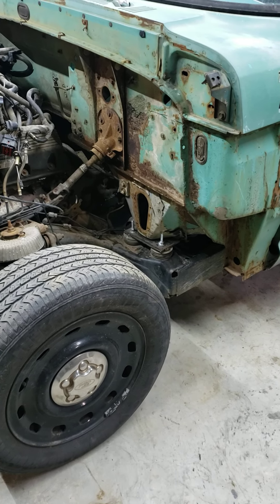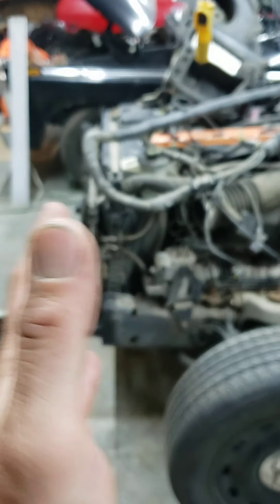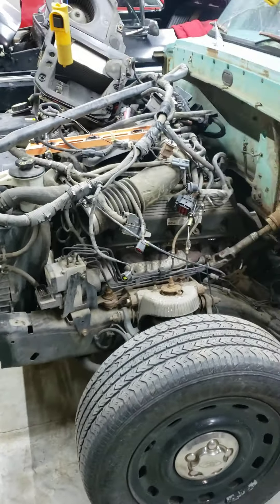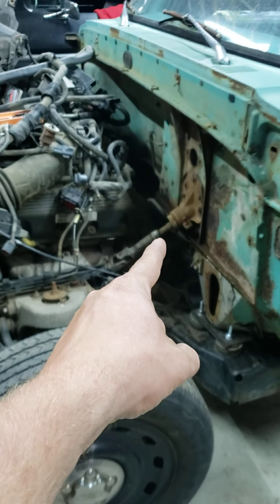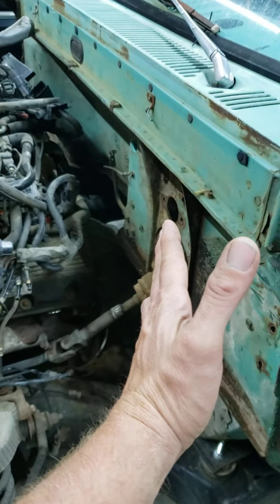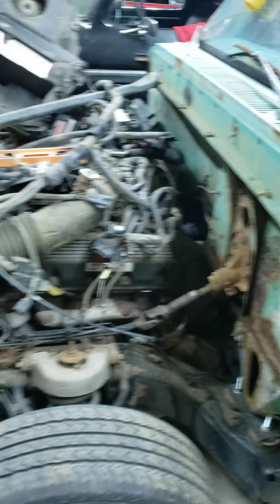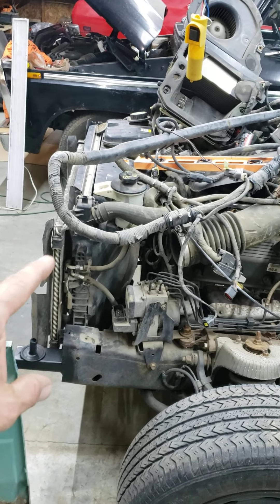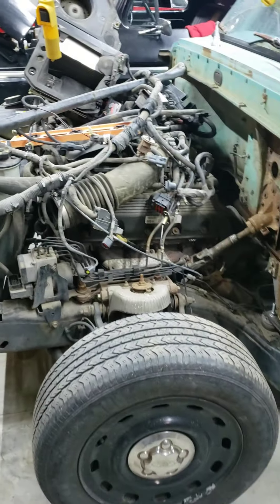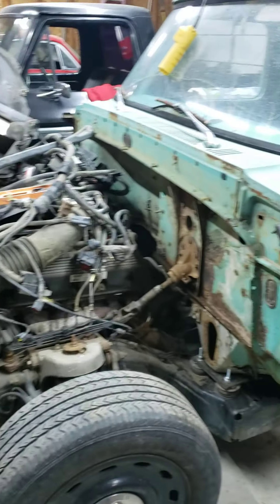A little bit will be blocked by the bumper but not a whole lot. Had some reworking to do since we're using the new-style cab front mounts — it slides the cab back so the wheels are centered inside the wheel well, which means the whole front of the truck comes forward more, so we have to play with that spacing. The more I look at it, the more I think it'd be awesome to shift the whole engine and drivetrain back, because as you can see there is a massive amount of room. You could really bob the front off and have plenty of room for the radiator. My dad mentioned going with a truck-style radiator as well — things to think about. Every time we do one of these, things get better and more perfected.